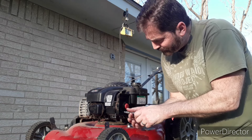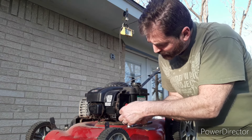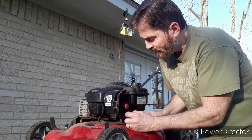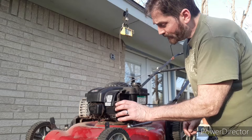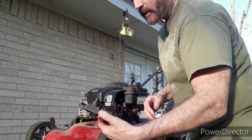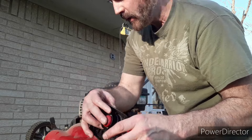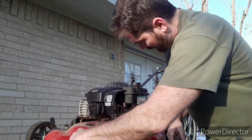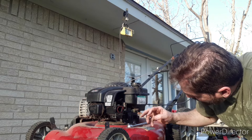This is going to get dirty. You're going to get some fuel on your hands, so if you like, wear some rubber gloves to keep the fuel off your hands. So this is what the cover looks like when it's pulled off. This is your prime ball — make sure that is in good shape and not cracked. Here is our carburetor. It is wide open.